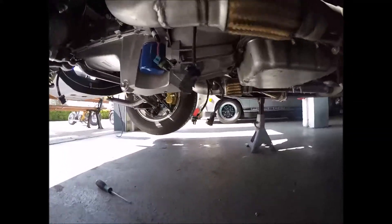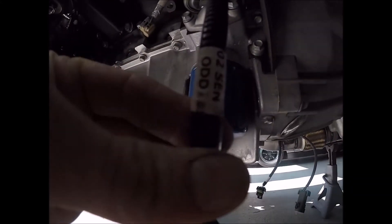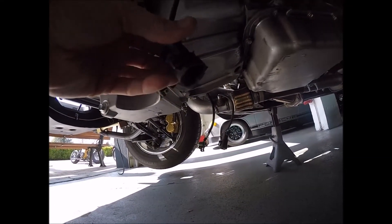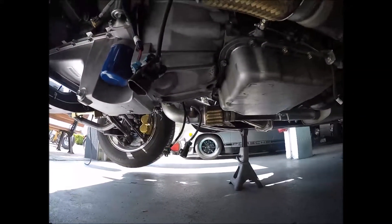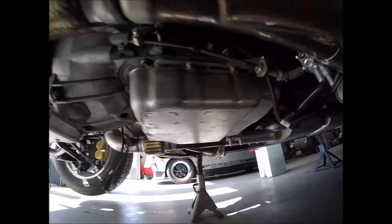You can see all my stuff is hanging down here. This right here is an O2 sensor - this is for the odd side of the engine, so odd-numbered cylinders. This right here goes to the oxygen sensor and that's the knock sensor - already got that one in there, so it's plug and play with those wiring harness connectors. Vehicle speed sensor is right back here and I just got to get to the other side of the transmission along with the controller. That's about it - take care, bye-bye till number ten. This is number nine. This thing is going to run but it's going to be close.